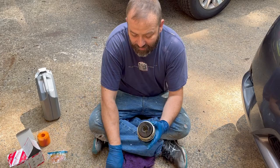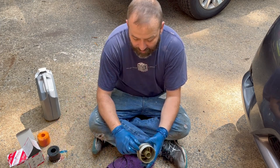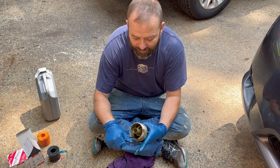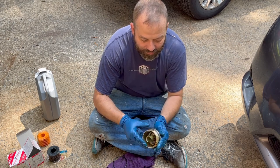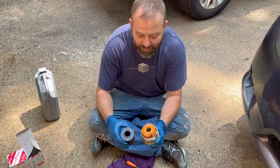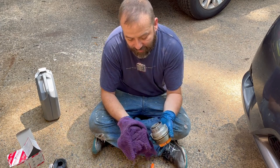That's the way that comes out and you see now why I got the rubber gloves on. You don't have to have them but it makes it a lot nicer. So this is the old oil filter, it's a Fram Tough Guard 9972 — I'll put a link in there for that too. You remove the oil filter like that and swap out the O-ring. This is the O-ring pick — you can use a small screwdriver if you want to. You just pull it off like that. This is the new one so I'm putting it right back on. I always coat it with a coat of oil so it helps it not to leak. Then you slide the new Toyota filter in there. All right, that's all you got to do for that, and then I just wipe off the outside of the housing.